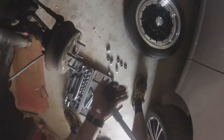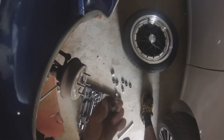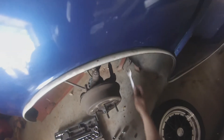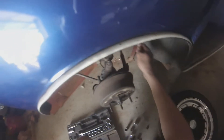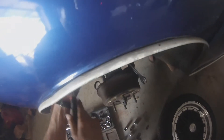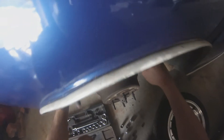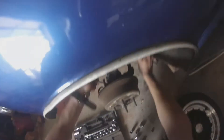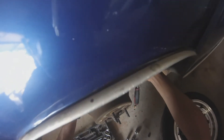Here it is — and it's a nylock bolt, it looks like. Interesting. Next thing, after disconnecting the tie rod that connects to your steering, is to disconnect the shock from your hub and the whole steering setup. It's 15 mil this side and 15 mil this side. There we go, just like that, it's off.